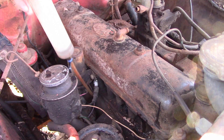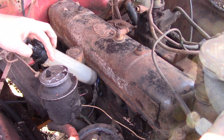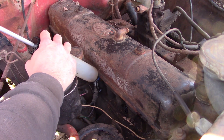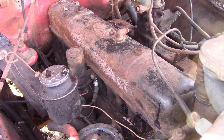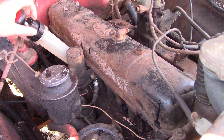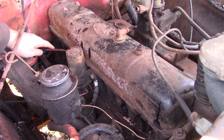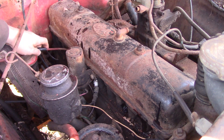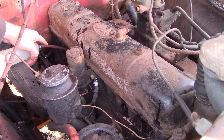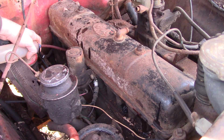I'm just sucking out any remaining oil that might be on top of the pistons using basically a big syringe, and then we can administer the Evapo-Rust. One rookie mistake I made before: I didn't suck the water out of the cylinder first. So if there was water sitting on top of the piston and then I put my diesel fuel ATF concoction on top of that, the water is heavier than the oil so the oil basically does nothing — it gets displaced by the water.